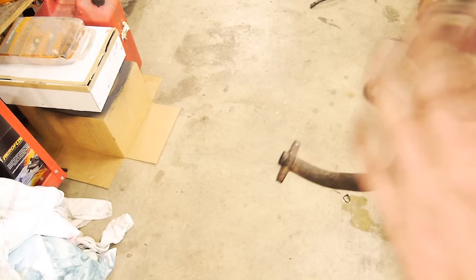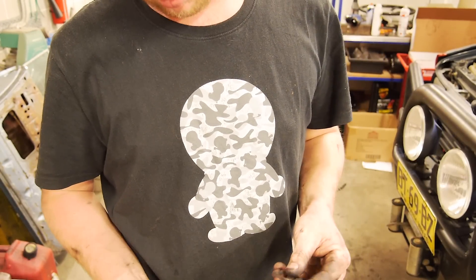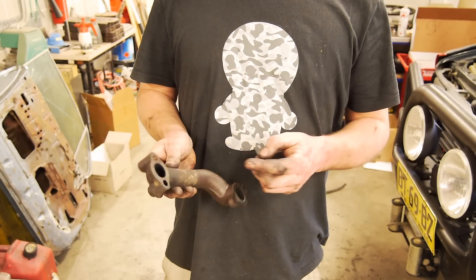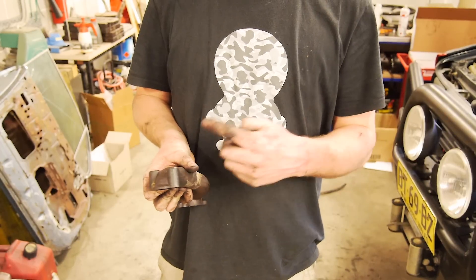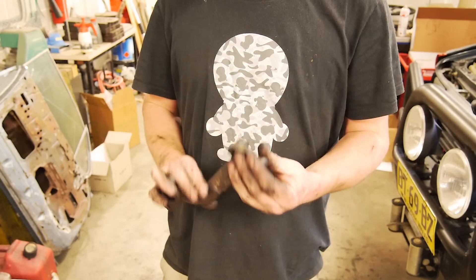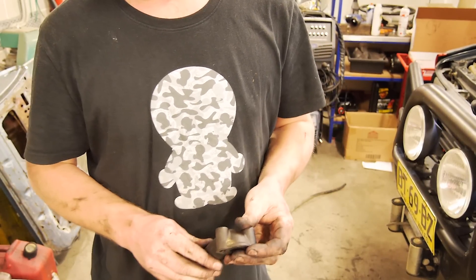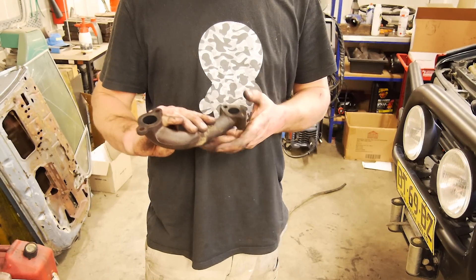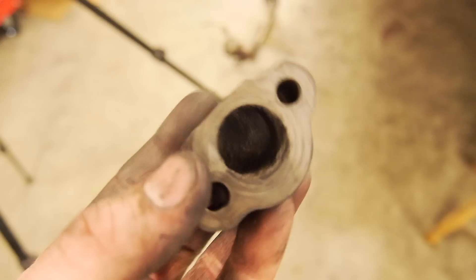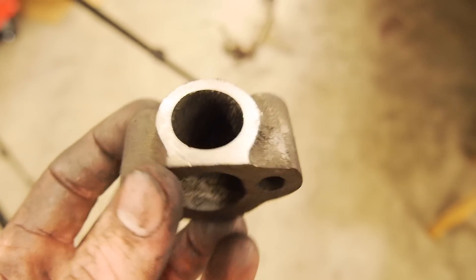Now it's just a matter of getting a blanking plate. Because I've got a welder and I can't be bothered cutting out a custom flange, I'm going to cut this off and plug it up — probably a 20-cent piece will fit on that — and just bolt it straight back onto the manifold. Later on I'll pull the manifold off and clean all that out, but for now I just need to get this ready to baseline it on the dyno, which is in about a week. I've cut it off — gone a little bit too close I know, but it's still going to seal.